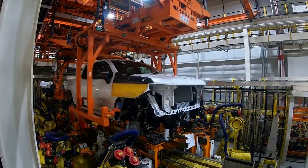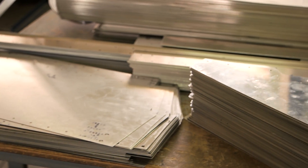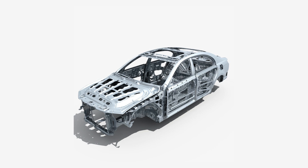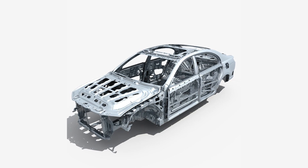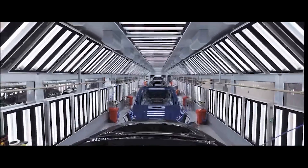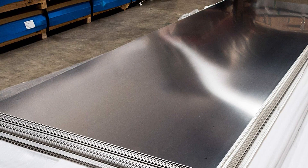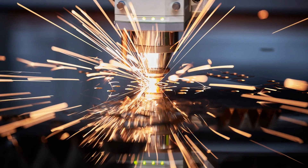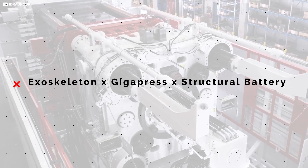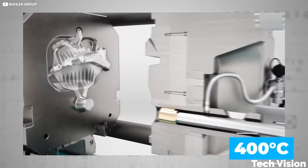So, to recap: yes, the stainless steel is heavier and more expensive than aluminum, but it is also much stronger, and that allows Tesla to delete the steel box girders from the traditional pickup design, while at the same time also deleting the upper body structure from the unibody design, and deleting the entire painting process thanks to the incredible resistance to corrosion offered by high-quality stainless steel. They also have a body that can be formed mostly out of one single sheet of stainless steel — it just needs to be laser cut and bent a few times by the press brake. Where things really get nuts is when you start to factor in Tesla's other manufacturing advancements already in production today: their Giga casting process and structural battery pack.